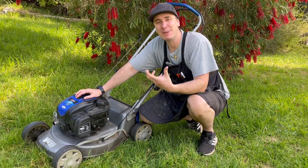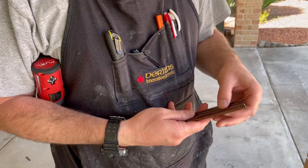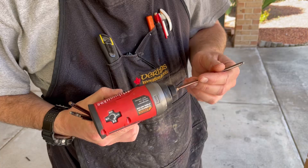If you've got an old screwdriver and a means of being able to heat it up, you can plastic weld your fuel tanks within a few minutes. So it's just a T27 we need for this process.